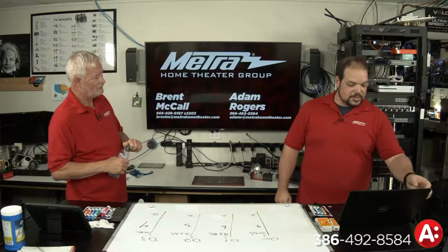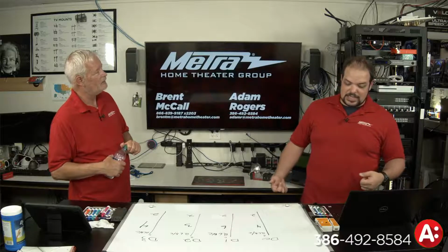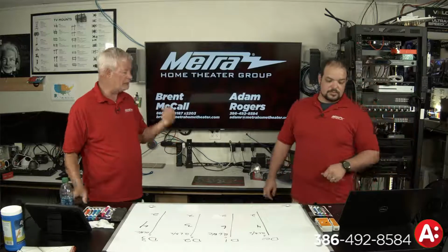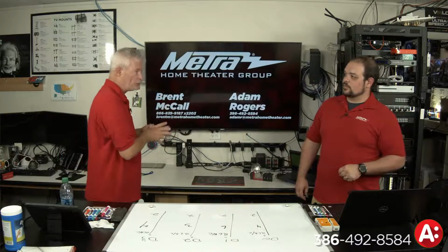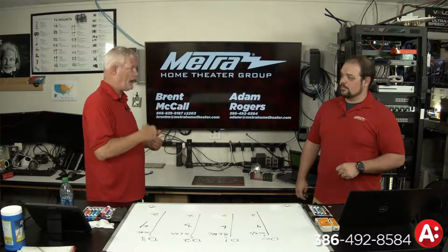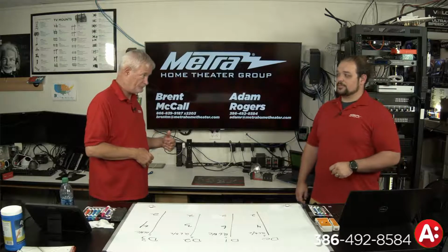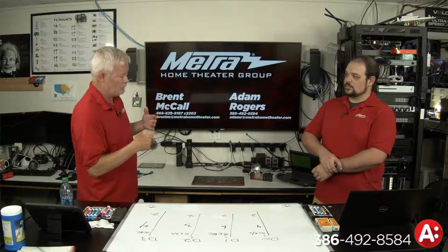Now, Phaetone is actually saying maybe the extender has a similar SBC as the Integra product. Yeah. And it's quite probable, when you look at Integra and Denon, both of those companies adhered very closely to the HDMI, EDID, and TMDS specifications. Yes. Some, Apple, Roku, Amazon, they play a little bit fast and loose.